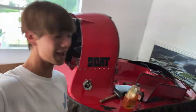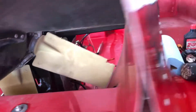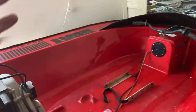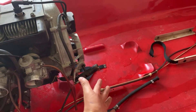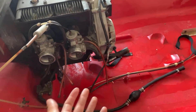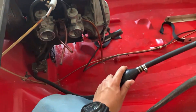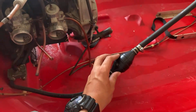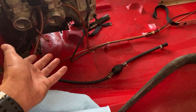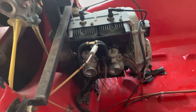We moved the hovercraft back into its place. So problems: rudder is slightly bent — not a big deal but it doesn't turn as well to the left as to the right. Right here, chip in the blade — probably have to replace that. Gas tank — this engine, the original is one cylinder but this has two, so it's a lot further out and the gas tank doesn't fit there. I don't even know if this has run with it. These vacuum fuel line hoses — no clue what they do. The primer thing doesn't squeeze — it is hard. So probably need to replace that. Engine — that's basically our main problem.